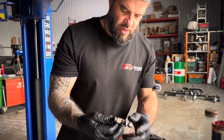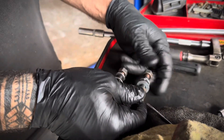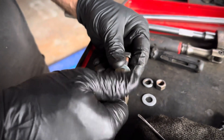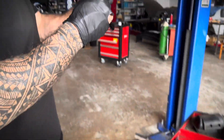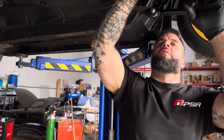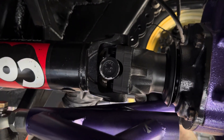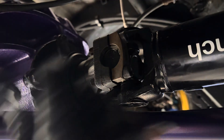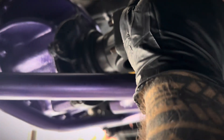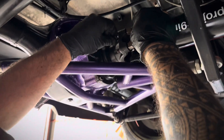These CNC cups are what hold the UJ in - high tensile strength bolts, very fine thread - that's what we use to clamp the bearing. I'm going to do this side first because it's easier to get through. They literally grip it and hold it. You put the washer on the back side, then a spring washer. I've got the funky US-size bolts and nuts because they're not metric - I don't understand why the US can't change to metric, but anyway.